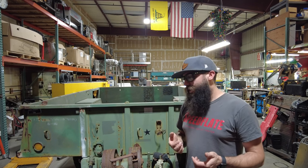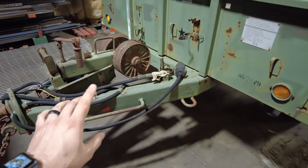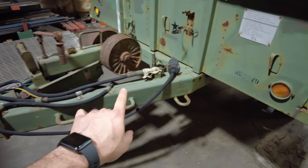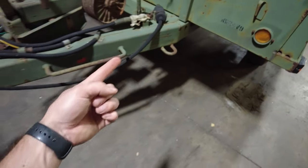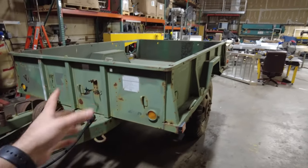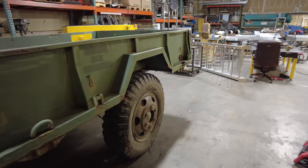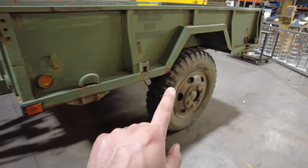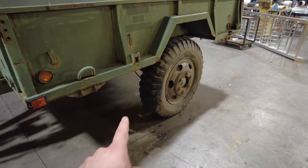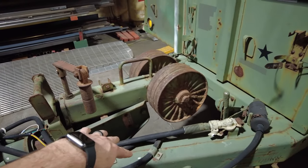There are some things we need to address first, like the weight. These are air over hydraulic brakes — the airlines hook up to the air brakes and then run the hydraulic brakes. Since this trailer is big and we're going to add weight to it, we need to be able to slow it down, so we may need to replace this axle with a more traditional axle with electric brakes. That should also save a lot of weight.